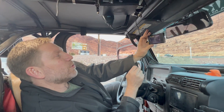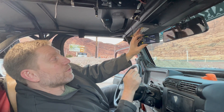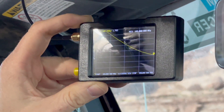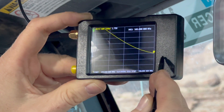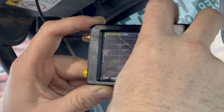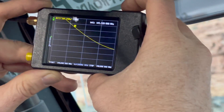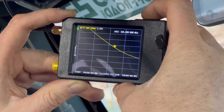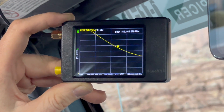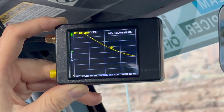This is technically a dual-band antenna, so let's check how it operates against the other band: 144 to 148 megahertz. We see a very different curve with the same antenna — it gets better as the frequency increases, meaning the antenna is now too short for this band. However, at the portion of this band I typically operate in, we're right at about 2.0, so the antenna is acceptable for this band, though less optimal than for the band we primarily tuned it for. A compromise would be to make the antenna a little bit longer, which will improve performance on this band but reduce performance on the other.